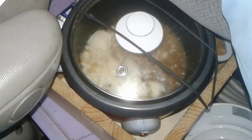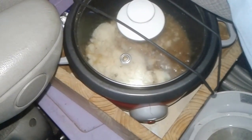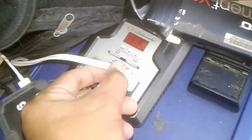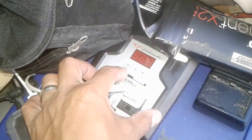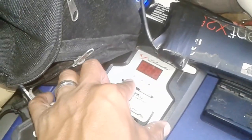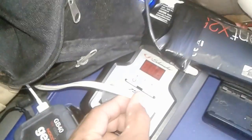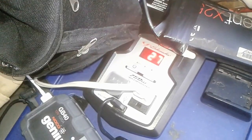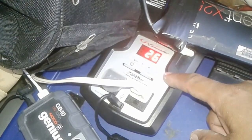Notice that throwing the light switch on did not start up the rice cooker — that's because the inverter back here still needs to be turned on. Let me get out of the car to show you what it looks like. I've thrown the switch to connect the vehicle battery to the house battery located in this box, along with the auxiliary battery tied together. To turn the inverter on I just hold this button down — had a bad contact, needed to clean it — but there we go, the inverter comes on.